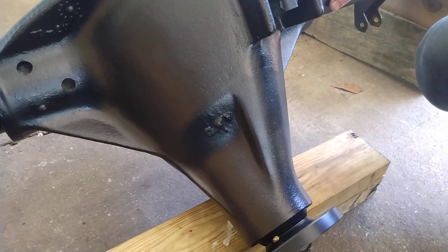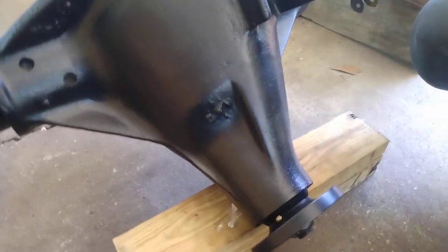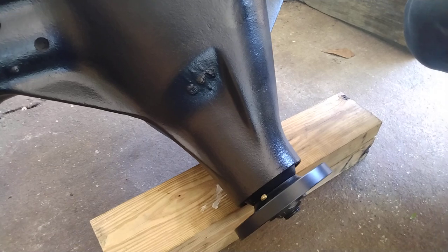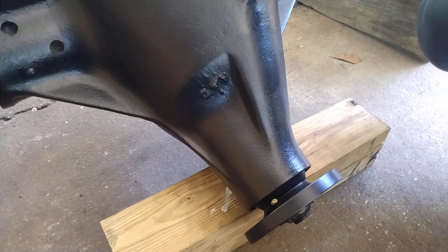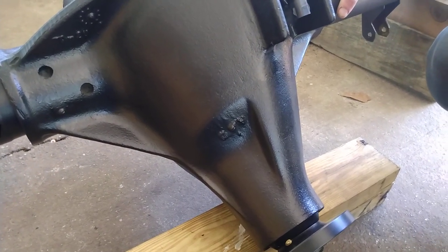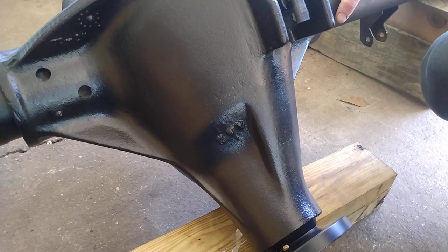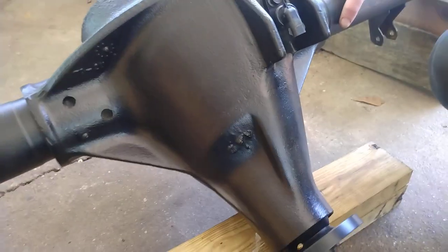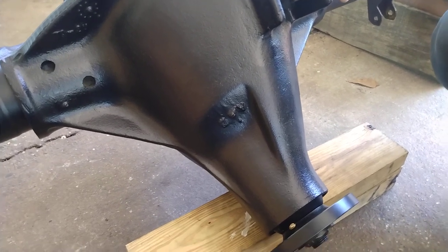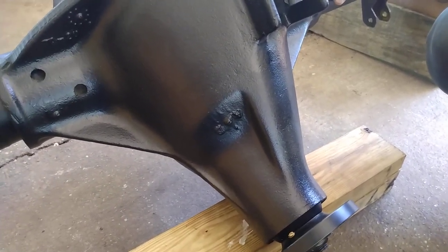This rear end weighs about 700 pounds. When you match everything — 4,000-pound-rated tires and heavy suspension — you can keep going up. We towed a 13,000-pound trailer with that Dana 60U back there, with three-and-a-half-inch tubes, without timbrons and without heavy tires. We had 3,100-pound-rated tires then; now we have 4,100-pound-rated tires, and we're about to have a 70U2 with timbrons. Theoretically we can tow up to 15,000 to 17,000 pounds, or daily-tow a 9,000-pound trailer like others do with these rear ends.